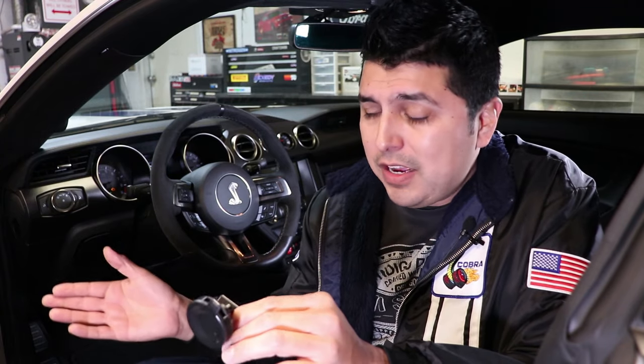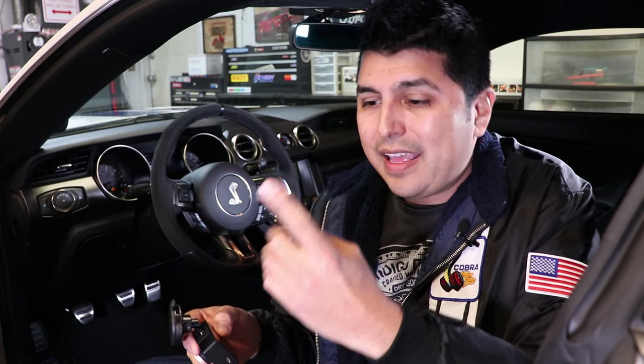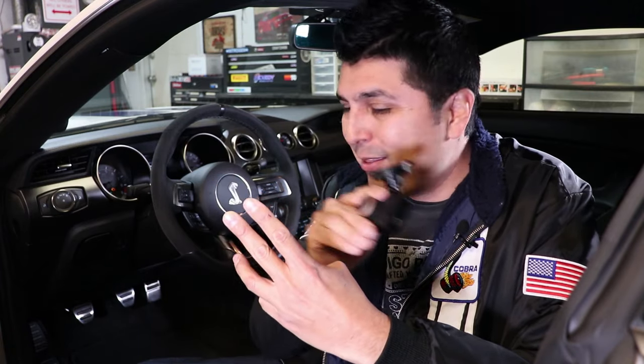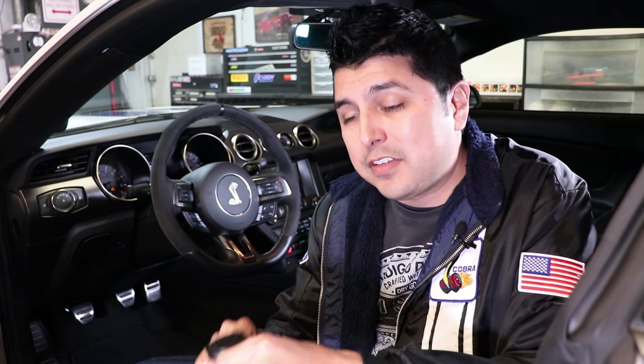Or let's say you're looking to leave it behind at an airport, and you're going to be away from the car for several days. It gets really tricky, because if an event happened on day one and you come back to your car on day three, that is long gone — it was overwritten a long time ago. You're only going to be able to see what happened eight hours before you arrived at your car. So surveillance mode would not be good for several days.